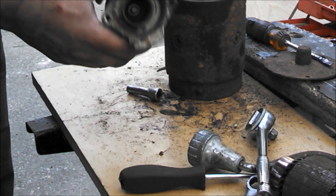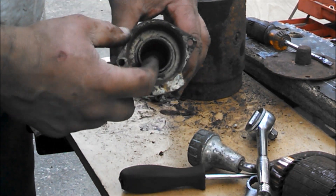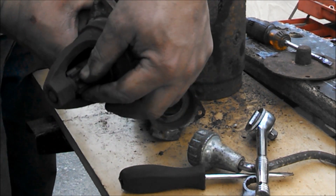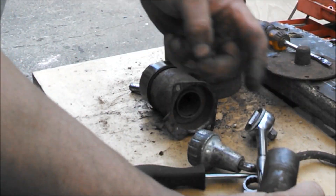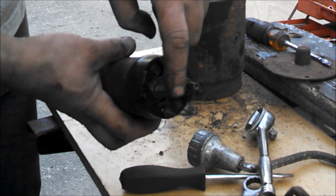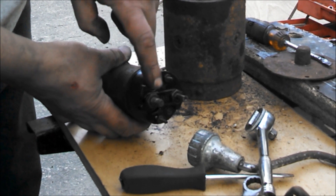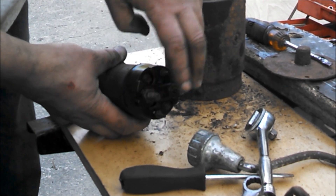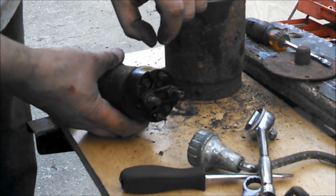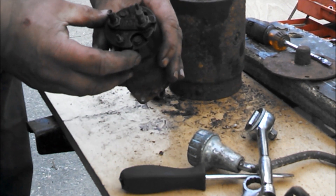Now on the solenoid — what this thing really does is when you energize the start terminal, it creates a magnetic field. It pulls a plunger in and causes the pinion gear to engage with the flywheel. Also, when that plunger goes in, it hits that button at the bottom of the solenoid, and when it hits that button it closes the contacts across these two terminals. This one goes down to the starter motor; this one goes to the battery — so it connects the motor right to the battery and causes the motor to spin. When you de-energize it, the spring pushes it back, the plunger gets retracted, the pressure comes off, opens up the contacts, and the motor stops spinning.